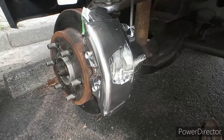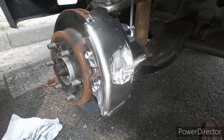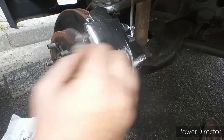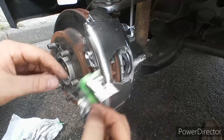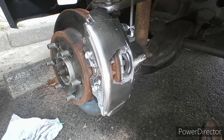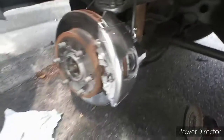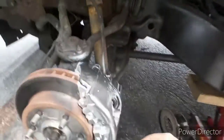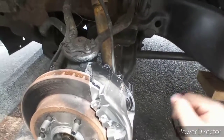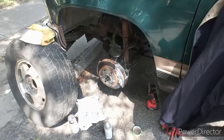That right there is how you do it - how you sand down your brake caliper, prime it, and paint it to make it look fantastic. Make sure you tape everything up; you don't have to, but it's good that you do so you don't have any issues. Also very important: tape up your bleeder valve, because paint will get down in there, clog it up, and next time you go to bleed your brakes nothing will come out. Don't forget to give the video a big thumbs up and let me know what you think in the comments.